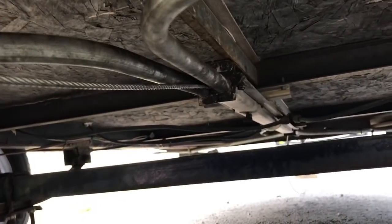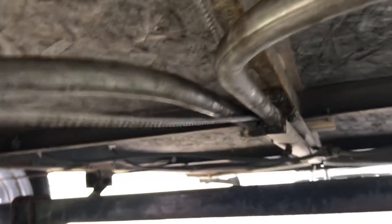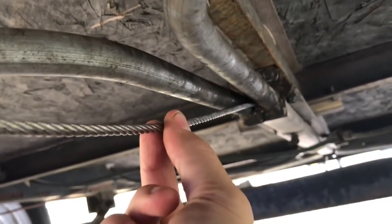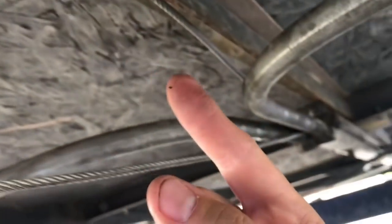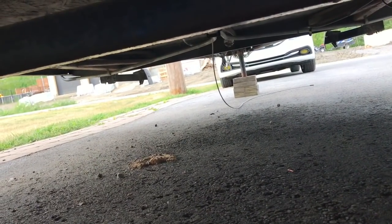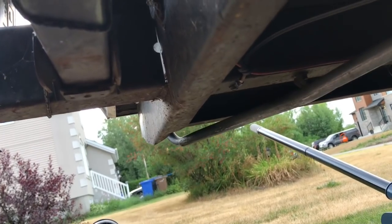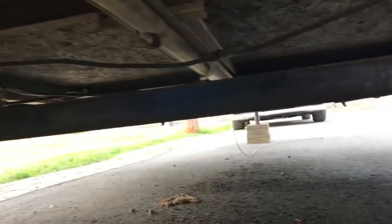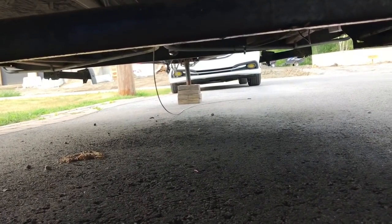As you can see, it's all put back together. We have the spring tubes back in place, cables run through. You can see how the lower portion of the cable pushes against the springs for the rear section of the roof — it comes around the pulley, through the upper tube of the main tube, the upper half, and runs all the way down. Our spring tubes are all connected and screwed back in — a reversal of what we did to take them apart. The next step is we're going to take that loose end of the cable, run it to our winch, and secure it in place.